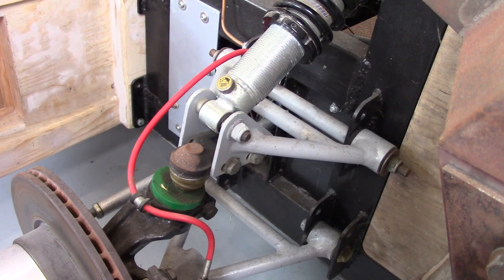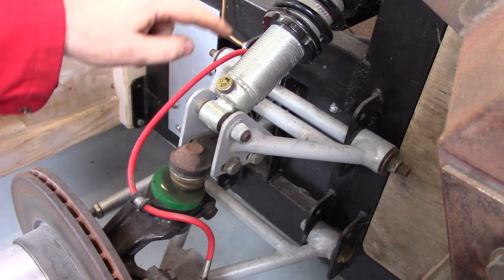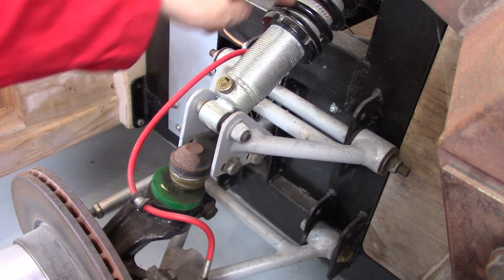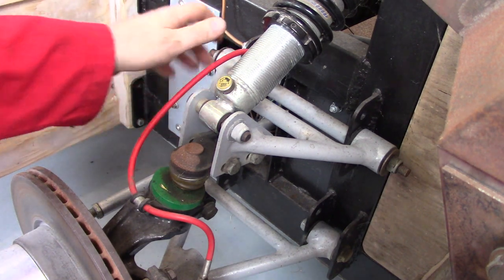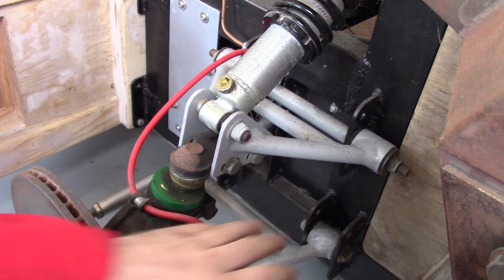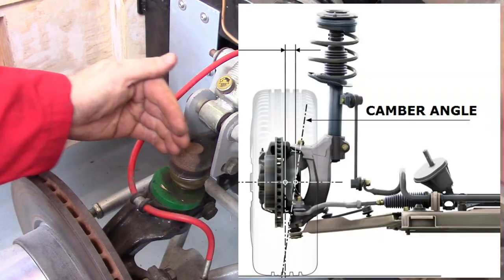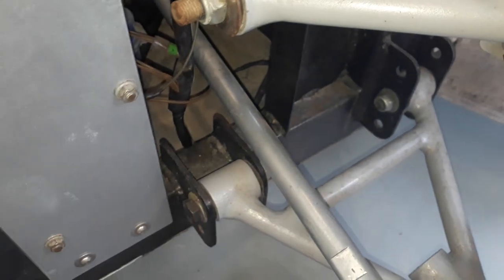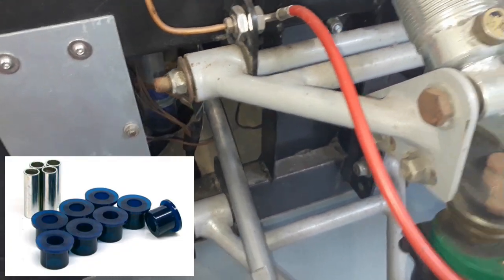As mentioned, the upper ball joint is from a TVR. The gas strut is custom — it is adjustable in height and also in stiffness. This custom upper wishbone here is also adjustable at two points for camber.